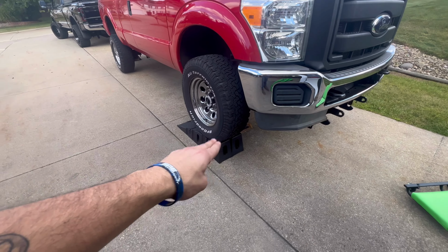So yeah, we're just gonna get right to it, guys. We're gonna show you taking the front one off. We're gonna start there and then keep on going. Look at that. This is what we're operating with. Here's our Dana 60. She's a little crusted up. I believe these are a 14 millimeter bolt. So we're gonna first start by zipping them out, get you a pan underneath, and I'm probably gonna go under the bottom with a flat blade very carefully and break the seal of the silicone so we can take this cover off and drain the fluid, obviously.